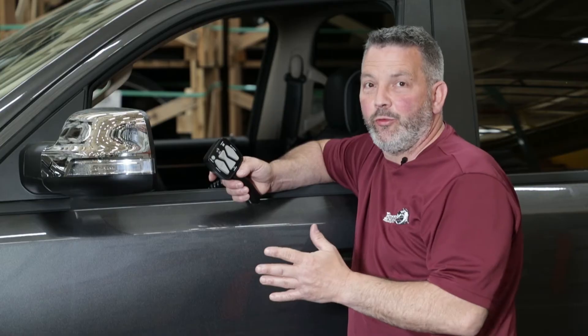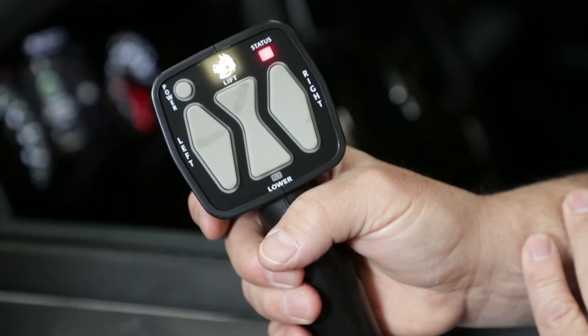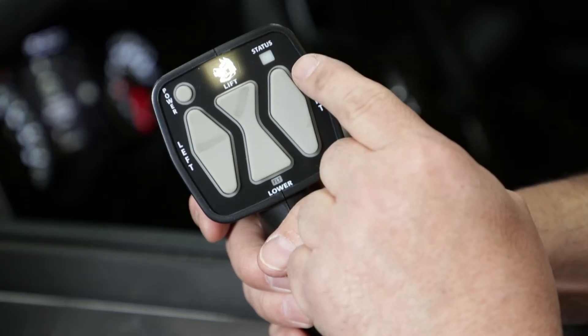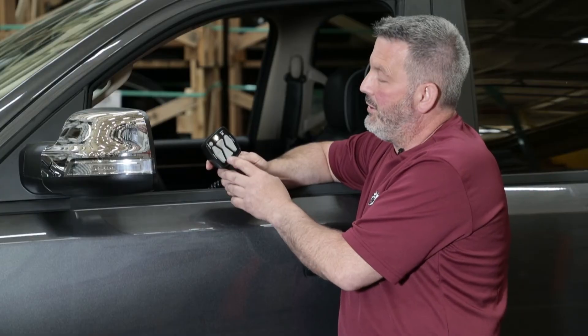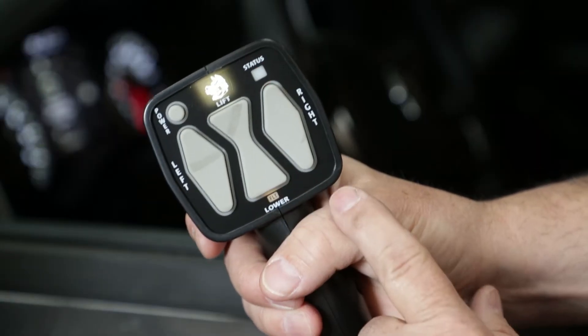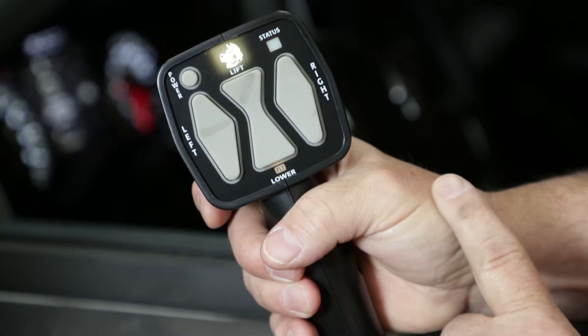Now that you have the proper tools, we're going to power up the controller and see if it's flashing. Right now it's flashing two times, which means it's my blue wire, my SA valve. So I'm going to put it into the float position — you can see the float light comes on — and now we're going to go check it out at the power unit.